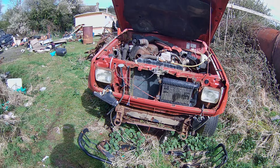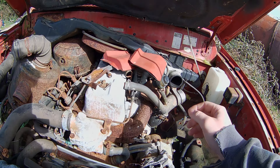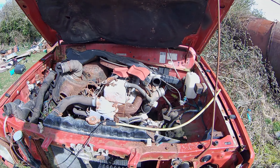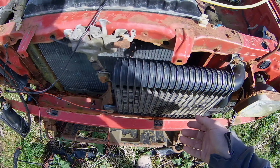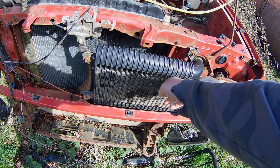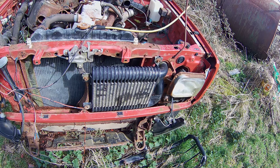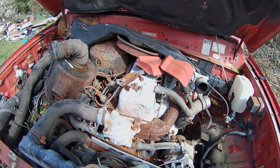I was just thinking I'll take it out of this because it's mostly parts. The one that's sitting over there is stripped anyway. I'm a bit worried about this turbo because the inlet pipe is off and the bonnet's been open for a few months. I'm not going to be putting the intercooler on - well, I might do. This is a different intercooler than the one on that one I think, newer model. I want to keep it really simple. I'm not even fussed about not having turbo because it's going to be so lightweight - it'll be fine naturally aspirated.